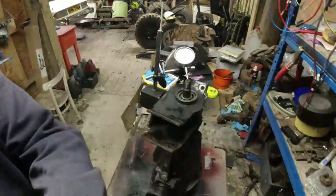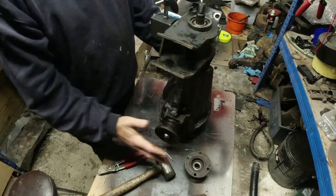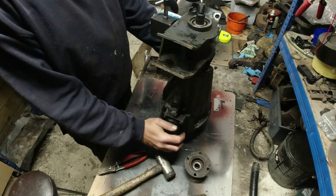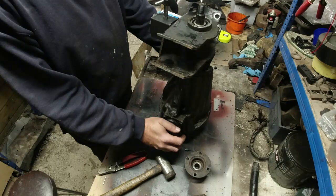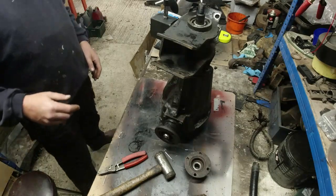So if I can look at the backlash, basically you've got the two output shafts. Hold one rigid and rock the other, and I can see there's no real backlash in that. There's a knock in there somewhere, but it's transferring straight through to the input shaft. I'll get the back cover off when I have a look at it, but first of all, let's pop a bolt in.